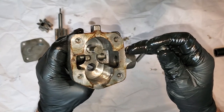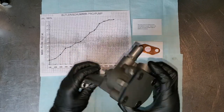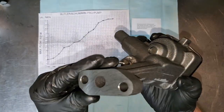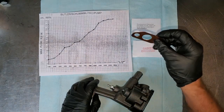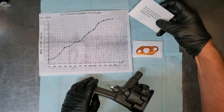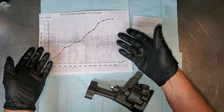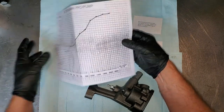Here's the pro pump. You can tell right away by the thicker plate and the machined surfaces for the bolts. This is lapped — nice and smooth for a perfect fit. It also comes with a copper gasket versus the paper gasket on the other one. There are shims included that can increase oil pressure by five to ten PSI if you want. There's also a flow chart showing 20 gallons per minute at 2,500 RPM.